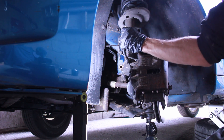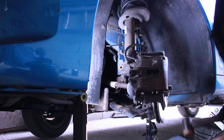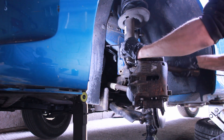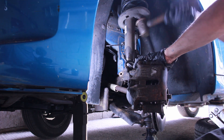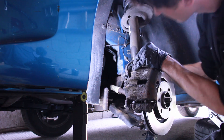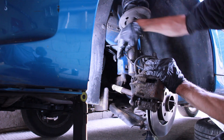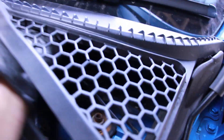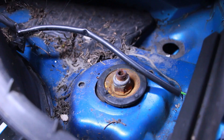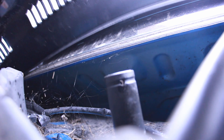Then we're using the copper hammer — we're not hitting on the disc here, we're hitting on the hub to knock it down. I'm tapping up and down on the strut assembly. It's the jolt often that does more work than the actual direction because it's quite tight on there. Giving it a wiggle and eventually the strut will be free. Notice I'm just pushing the driveshaft in to make sure the driveshaft doesn't pop out the gearbox and to make sure the ABS line doesn't get in the way. Now at the top of the car we pull the little rubber strip out of the way and then all we need to do is gently pop the trim up and out of the way. There is a 21mm nut that holds the strut in — that's the last job. We're going to get a cheat gun on it again; it just saves time but hand tools work fine too.